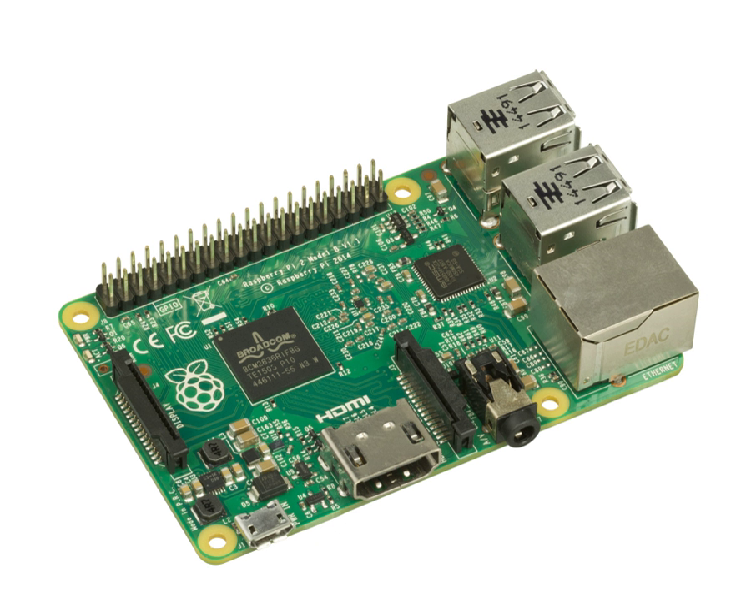As the PC market became more prevalent, fewer SBCs were being used in computers. The main components were assembled on a motherboard, and peripheral components such as serial ports, disk drive controllers, and graphics processors were located on daughterboards. The recent availability of advanced chipsets providing most of the I/O features as embedded components allows motherboard manufacturers to offer motherboards with I/O traditionally provided by daughterboards.